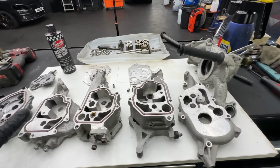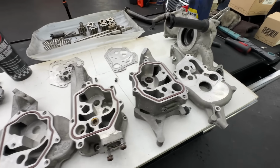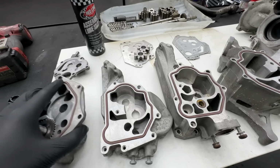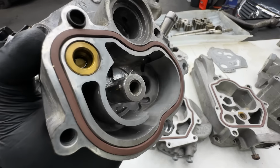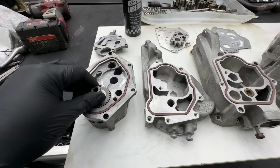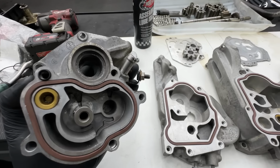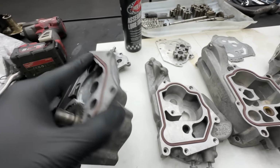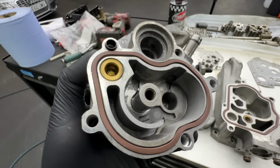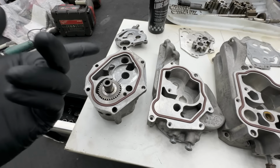This is what I get so far. I think it's pretty much cleaned up, well, as much as our facilities let me clean it. I will tell you the truth, I did mess up this part. I couldn't remove the lock for the sprocket or for the gear wheel. And this is already for the old oil pump, this whole housing. I didn't damage it like the other one, which is on there, but I wasn't really happy with it, and it didn't look good. So just to make sure, I put in the housing from the other oil pump, which was originally in the car.